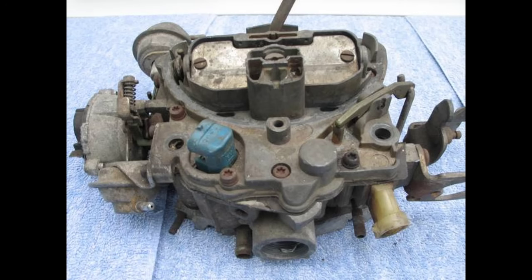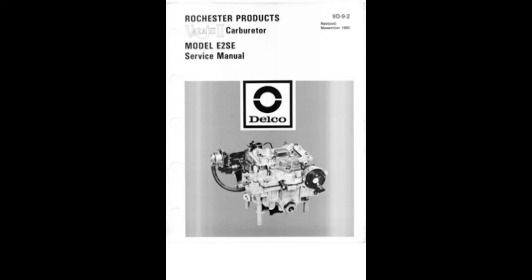The ECU took the information from its sensors and determined what type of load the engine was under. It then factored in what the driver was trying to do with the throttle and determined how much fuel the engine would need to perform while keeping that ratio of air and fuel as close to 14.7 to 1 as it could. It used the oxygen sensor located in the exhaust manifold to see if it was doing its job. As the exhaust got richer or leaner, the voltage emanating from the sensor would change, giving the carburetor constant feedback on whether the changes it was making to the mixture were working or not. Hence the name, Feedback Carburetor.